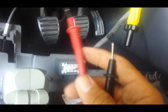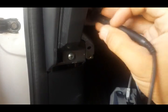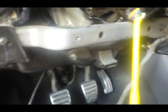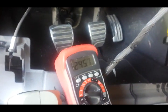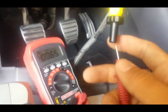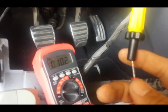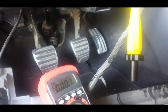With the multimeter, you're going to ground one side somewhere on the car, then touch the tip right there, and you should see it go to 12 volts — like so, 12.45 volts. Let go, touch it again — you see how it's a 12-volt constant. With the key off and nothing going on, you know that's a constant power wire.